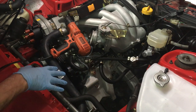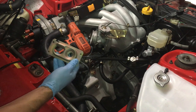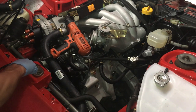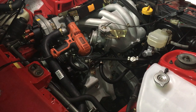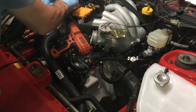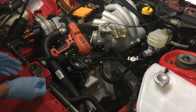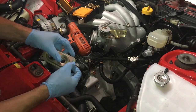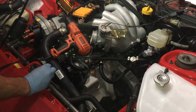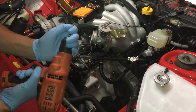The first thing I want to do is continue cleaning up this engine bay, and I'm going to start right here by replacing this old hood latch. You can see that I've got one here freshly plated. In order to remove the old one, all you need to do is remove the cable and then drill out these four pop rivets. Make sure that you use a bit that is about the size of the hole — if you go too large, you may end up drilling out too much material and then you're never going to get this back on. Once you've got your bit selected, then you're just going to take your time.